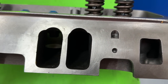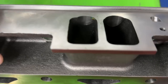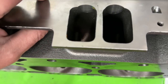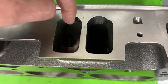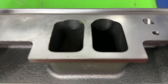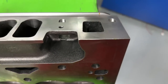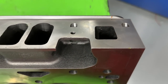This ugly-looking thing — you're thinking it's not a Vortec pattern. It looks like what Dart did: the ports, if you just squared them, would be the regular square port 165cc runners. But it looks like they just said, we can convert these to Vortec to get the injectors, because the stock Vortec had an injector — if we just cut out a little groove right here at the top of the port. And that looks like what they've done. They just cut a little groove. As far as the intake pattern, instead of drilling and tapping the holes for a conventional small block, they put the Vortec pattern in — and that's all they've done.